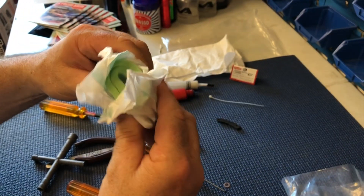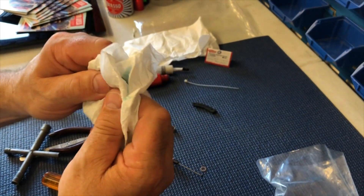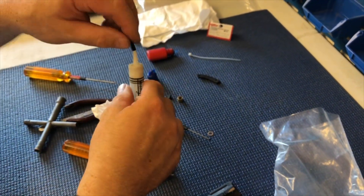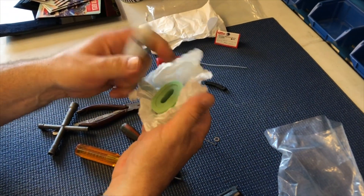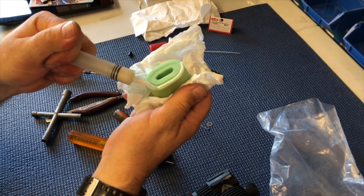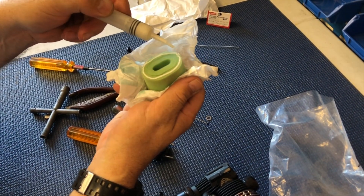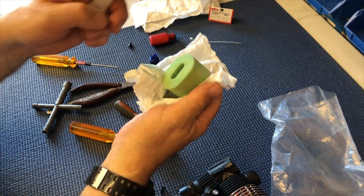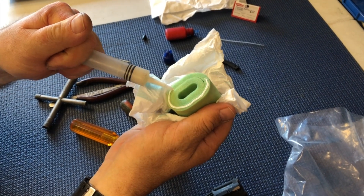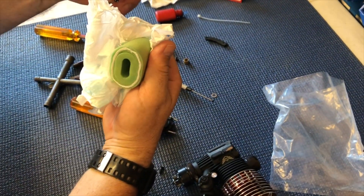Don't wash the filter out — throw it away. For the expense of it, consider how much your engine costs: one piece of dirt and your engine's ruined. Once you've got that, as a secondary safety feature I get some white tacky grease and apply that around the outside. You can see it's quite sticky — that just catches any dirt if the filter gets pulled away during heavy jumping or impact, which could allow dirt to be sucked in. That's just an extra precaution.